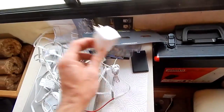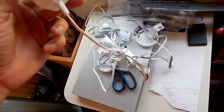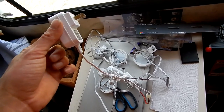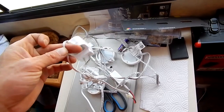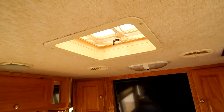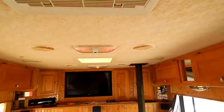But you can actually hook these up to the strip lights if you want. They come with the same standard plugs on them. Now, of course, being Home Depot, they don't sell 12 volt stuff. It's all 110, but they're still 12 volt. All you have to do is cut the wire off. You don't need the house plug, and just wire it to any connection in your motorhome because LEDs are 12 volt inherently. So all I'm gonna do is cut that and connect it to the power source from one of the lights that are already up here, and we're gonna drill holes in my ceiling valance for the new puck lights. We were gonna do the valance all the way to the back, but I think I'll leave the back as it is and just have it like a living room centerpiece.